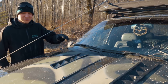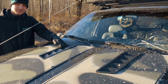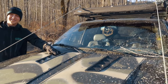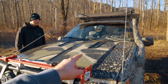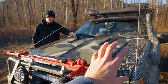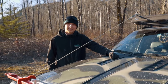One of the most nerve-wracking things I had to do was install these louvers — cutting your hood for the first time is definitely a rush. These engines are known to run really really hot so I wanted to give them a little more room to escape that heat. These are functional, not just for looks. The snorkel actually came way before the louvers. The fan belt on this is mechanical, so unfortunately when I'm doing rock crawling and moving quite slow, heat has a really big problem getting out.